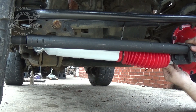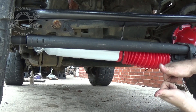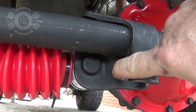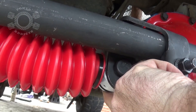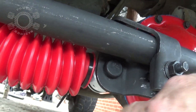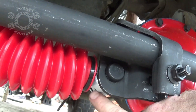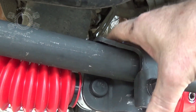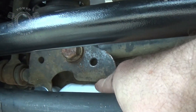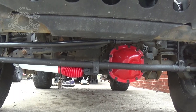Take your nuts on each end of the steering stabilizer and tighten to 35 pounds and you're done. One important point: before you torque the nut down here to 35 foot-pounds, torque this one down first. When you start laying the torque to the second nut, it'll turn this whole bracket if you haven't tightened the first one down. So tighten this one first, then the one back there, to prevent this thing rotating on you — because remember that twisting affects the gap up here.